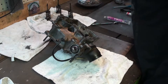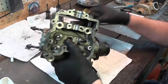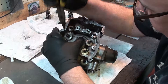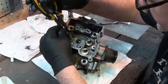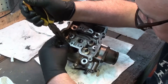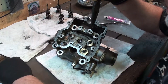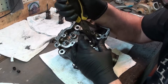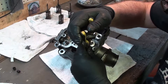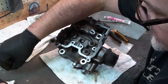I got it all cleaned up. Now I think what I'm going to do is pull these old valve seals out, because we're going to replace them. I'm just going to take my needle nose and pull these guys out. Yeah, these are worn out — good thing we're changing all this stuff out. That rubber is toast. Even if we'd have got her back together without changing these, I bet it would have smoked. So we've got the old ones out — I'm just going to throw these away.